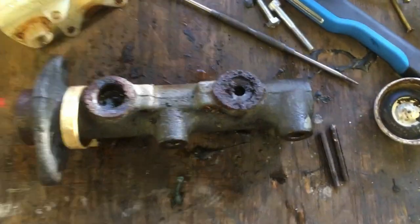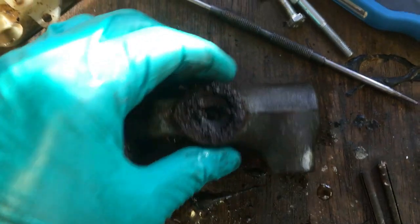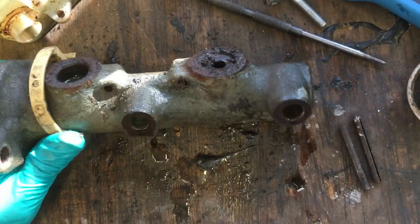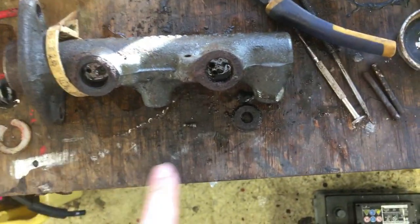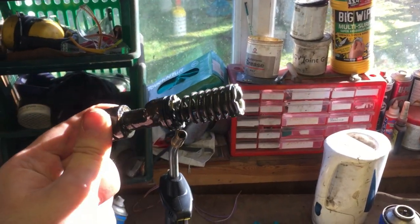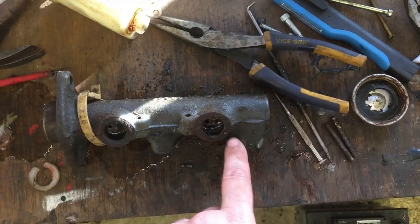To get the guts of this thing out you need to remove the nylon circlip, and behind that seal is a little bobbin - you lift that out and that allows the second cylinder to come out, which is for the rear brake lines. Circlip out, and there's the small bobbin. As soon as I pulled it out, this lot shot out forwards which shows it's not seized and no significant wear lip has built up. Once again, check that out - no real rust buildup, so it doesn't look like water's been getting in. That's the front brake circuit.